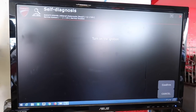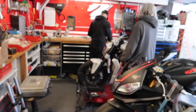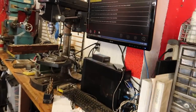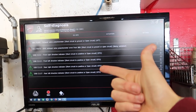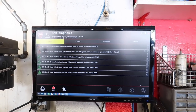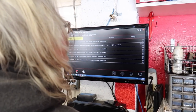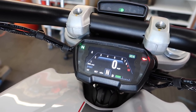So we've got the diagnostic tool hooked up right now and resetting the first service code. There are a few faults showing, obviously, because we don't have the up-map yet — which we're getting — and stuff from unhooking the turn signals and things like that. Nothing important. The service light is off, which is also the oil light. Now we're good to go. Thank you, buddy.